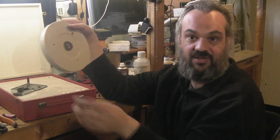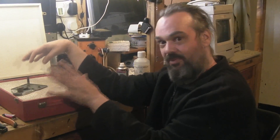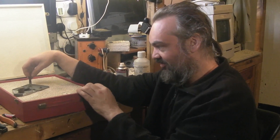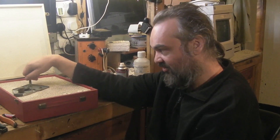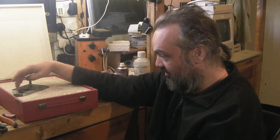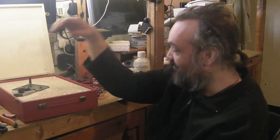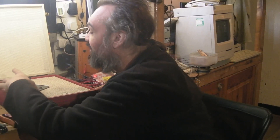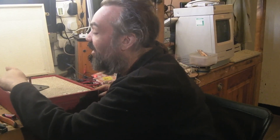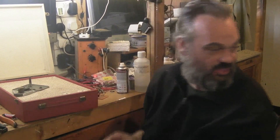These just pull off — on the other deck you have to pull a circlip off to remove them. I've already gone through this deck and regreased it. Most of the issues with these cheap little decks is this spindle on the early ones tends to seize up — I've already taken that off and given it a little bit of grease so it's nice and free now. The idler's in pretty good condition too. As you can see that is fitting down really nicely, and the good news is we can get all the screws in there.